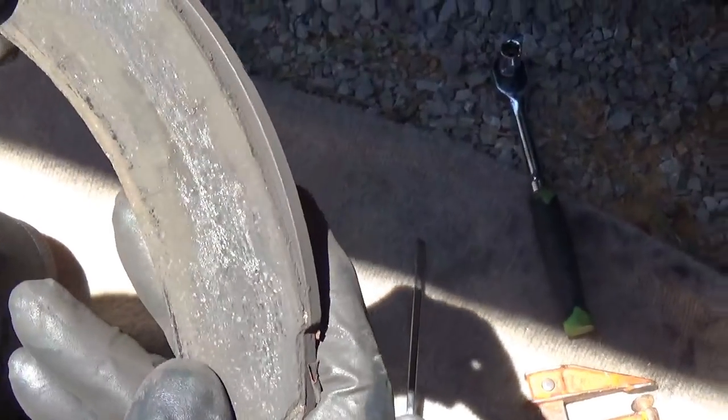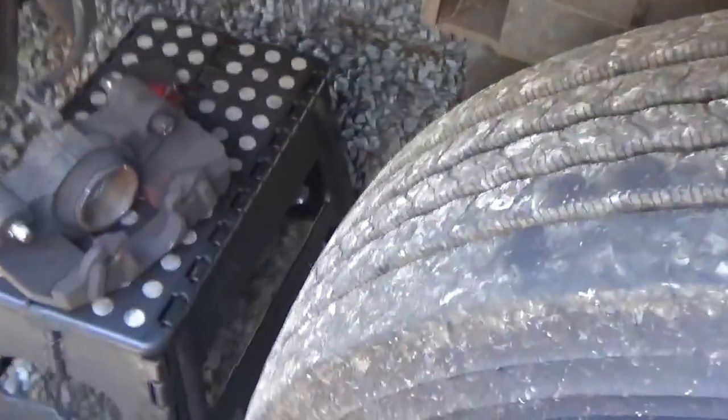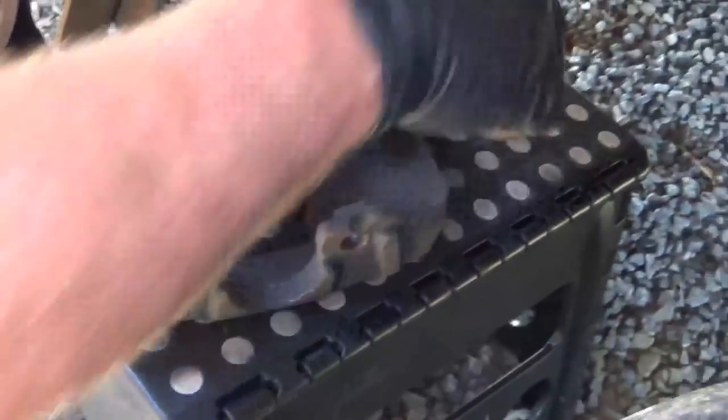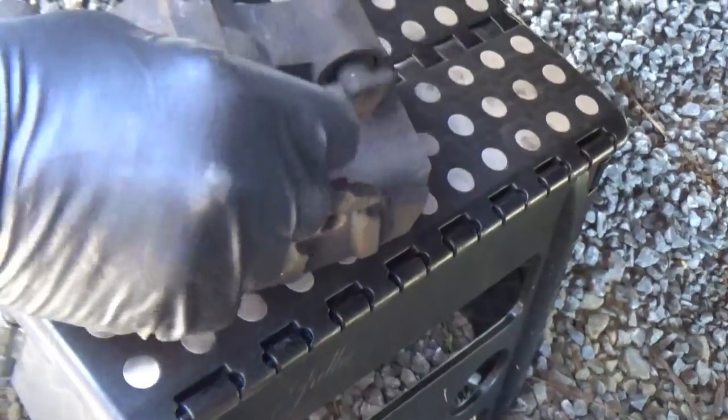See, that one's mighty thin too — look how thin that is, there's like nothing on it. It should be at least an eighth of an inch, if not more. About a quarter inch at least. It's almost like it's been dragging or something. That's what it was doing.